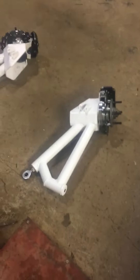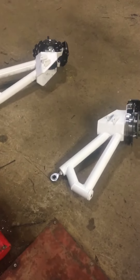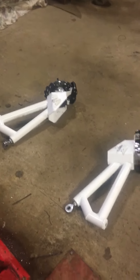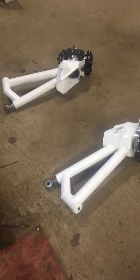Built his arms up to the rears. Again, obviously you have all threads tapped — we don't mess about, we tap them all. I see many people that just drive rose joints in and then wonder why they're sat at the side of the track at a race meeting trying to get them out. So we tap every thread, copper slip every rose joint.